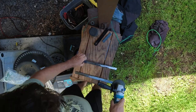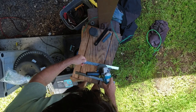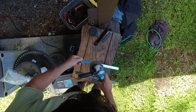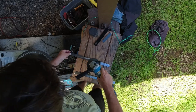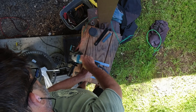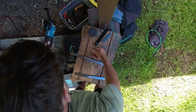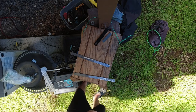Before I got started, it seemed easier to grind off the finish that comes with any kind of steel stock. I'm just going to knock off the mill scale so I can paint it and make sure it doesn't rust. I live on an island next to salt water and everything rusts down here, so I'm going to take off the mill scale so the paint sticks to it, then repaint it after I scratch it up and put holes in it.